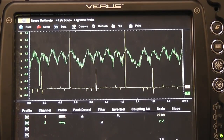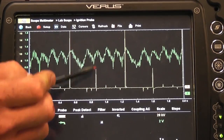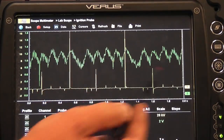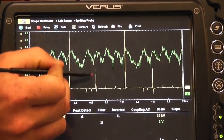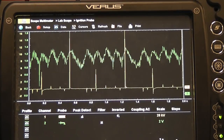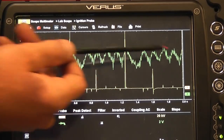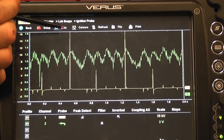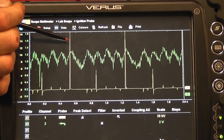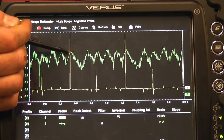You can see the yellow trace is actually your number one cylinder firing — this is number one, all the way across. What you're looking at is low, high, low, high, low, high. That would be what you would expect from a waste spark system where it's firing on compression and it's firing on exhaust. So the yellow trace is our sync and our green trace is our amperage from our starter. Number one on compression is when the spike is high, so this hump right here would be the number one cylinder.